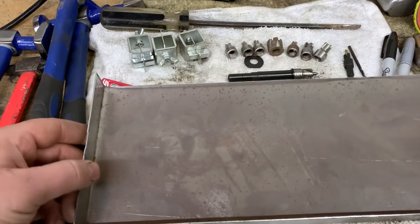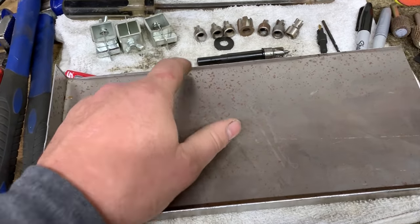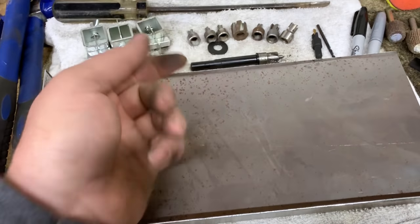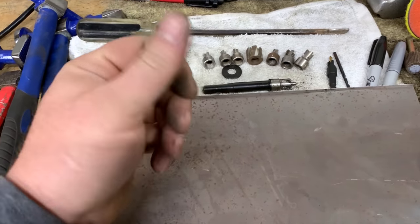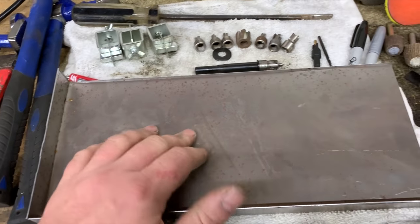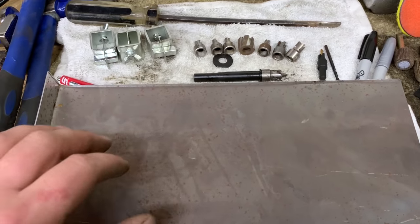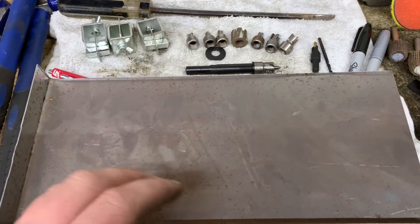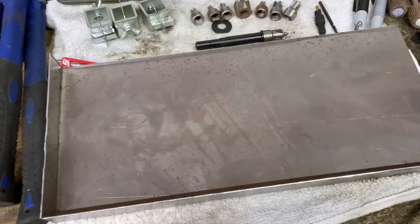And sometimes it's a quick process, and sometimes the first time you wash it, it'll get moisture behind it. And then the first time you have a cold day or something like that, and that moisture gets cold, it's really going to push that Bondo out. So you could repair a panel and then 6 months later, all your Bondo has fallen off of it, because you just didn't take the proper prep to ensure that the panel is repaired nicely.